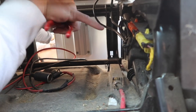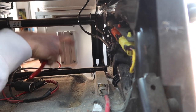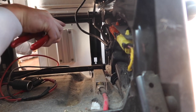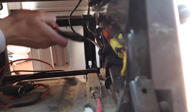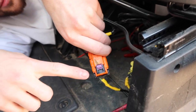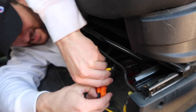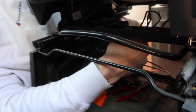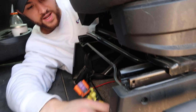Before we get those completely off, I want to go under the seat and disconnect the airbag connectors. So now we're under here with the airbag connectors — we need to remove those. All these wires connecting to it are strapped to the base of the chair, so we're going to need to cut that zip tie. Once we get everything disconnected, these wires will be free. We undo these clips by pulling this little purple tab, then disconnect.